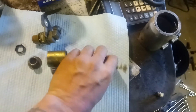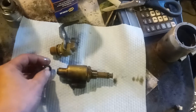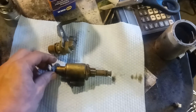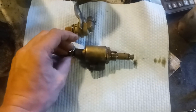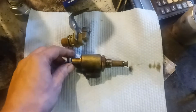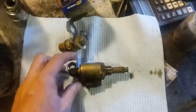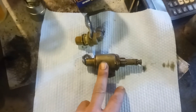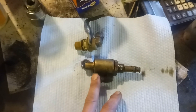This is the injection pressure regulator on the high pressure oil side. It's down in the front in the valley at your high pressure oil pump. They have this little tin nut, and sometimes the same kind of symptoms will happen with this — the nut comes loose and you tighten it back up or whack it a few times and it starts working again.